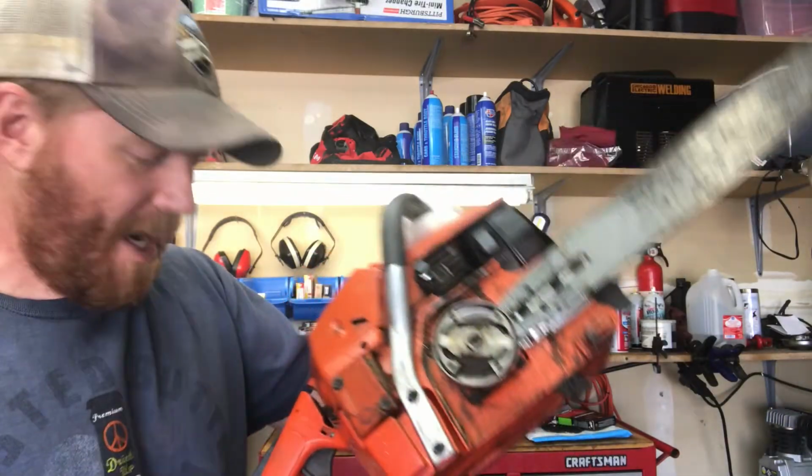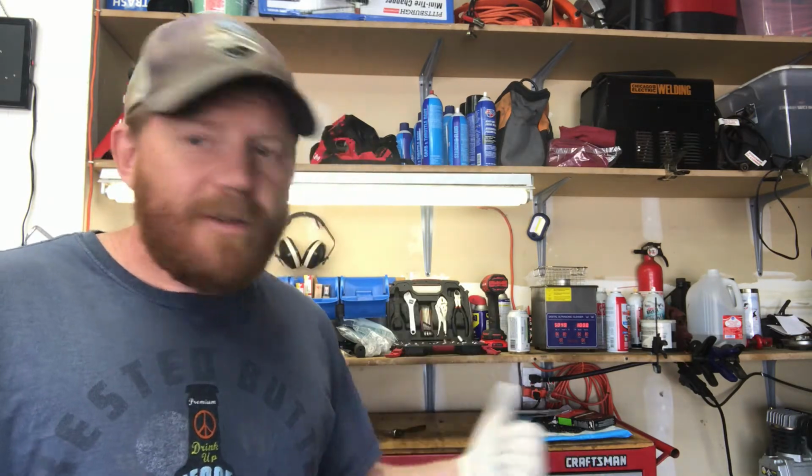All right, this is the Husqvarna that was brought in to me. It needed a tune-up. I've already made sure that the oiler is working correctly for the bar, changed the spark plug, and put a new air filter on it. It runs great. I took the exhaust off and inspected the piston because I was told it was run with a really dull chain. You always want your chain sharp, so the saw is cutting at its optimal. With a dull chain, the saw is really working hard to make a cut, and if you're revving it high and grinding it in there, you can do damage to the piston. It looked fine. I tried sharpening the chain and it still wouldn't cut right, so I went ahead and ordered a new one.